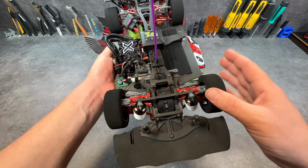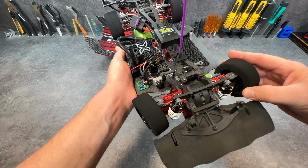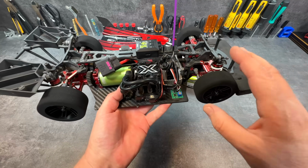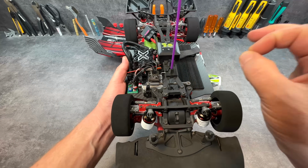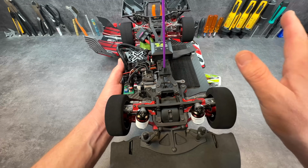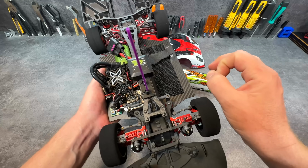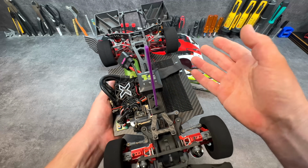If you don't, and your gyros are, for example, reversed, if the nose goes here and the wheel goes here, obviously you're making the problem worse. A lot of you guys out there don't really calibrate your gyros properly. When it comes to the gain, if you set it right, you don't know it's there. So one of those rules of thumb with gyros, if it's set up correctly, you don't feel it when you drive. You just have a very, very stable car and very forgiving.